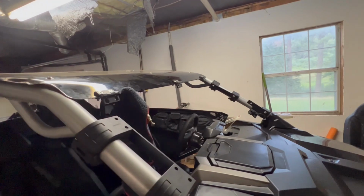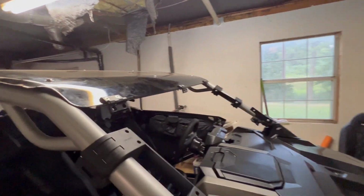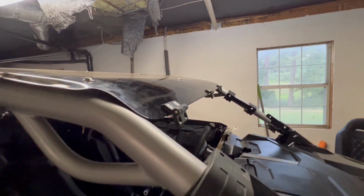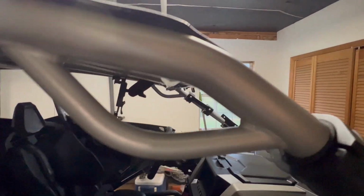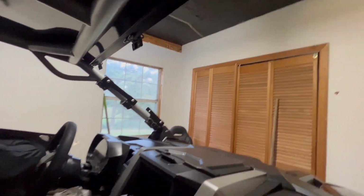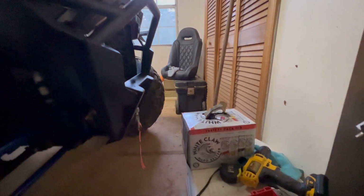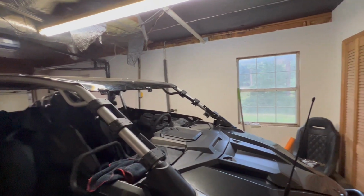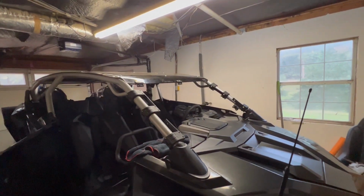All right, once you get the hinges on, the process I was at, that's what they're gonna look like into the roof. Got all three of them. Like I said, you're gonna need to line that bar up the center. I think it was 19 and 7/16. That's what they look like from the inside. The drill bit you're gonna need was a 15/64 drill bit, and that's all I can do tonight.